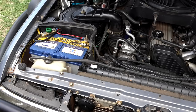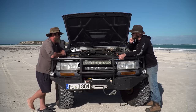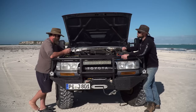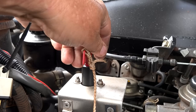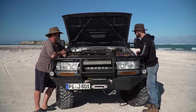There are two batteries under the bonnet. The European 80 Series originally had a 24-volt starter, but Marco swapped in a 100 Series starter motor to bring it to 12 volts. The main cranking battery can be isolated via a simple isolator key — Marco prefers simple, reliable switches over electronic systems. Battery mounts were accidentally left at home so straps are being used.